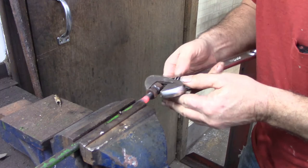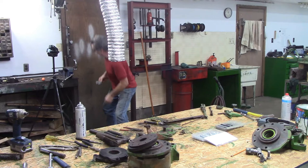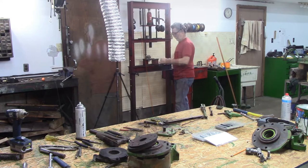It's not real hard. Put some heat on there, put the nuts on to protect the threads, and then just take a crescent wrench - I think that's about all that needs. I'm just going to leave that sit there and cool and I'm going to go on to pressing that shaft out of that arm.